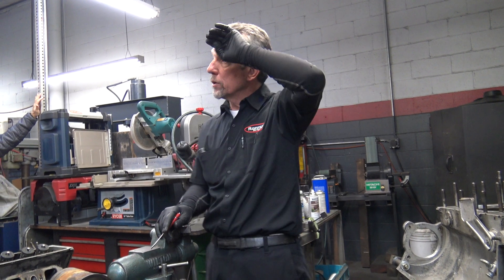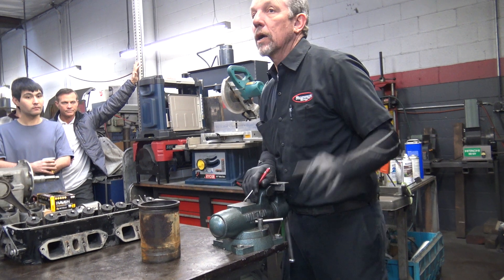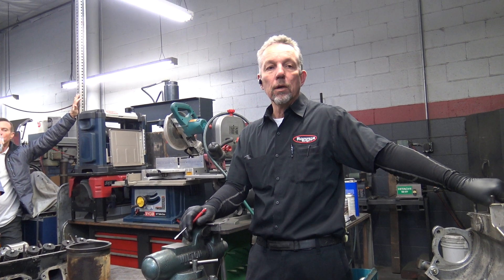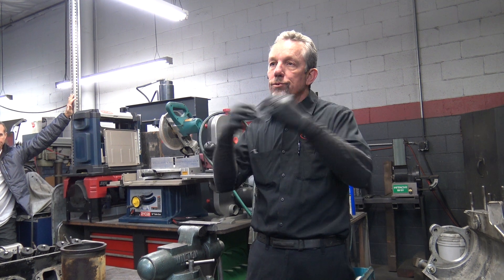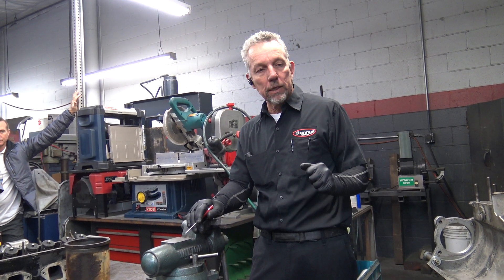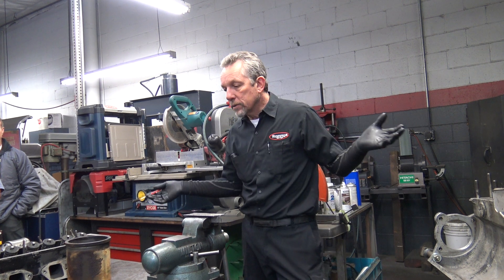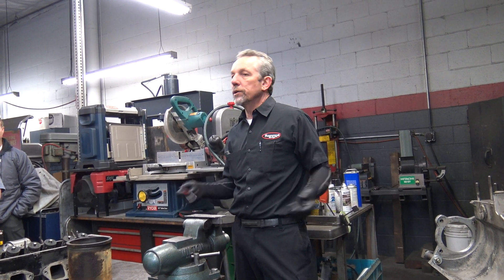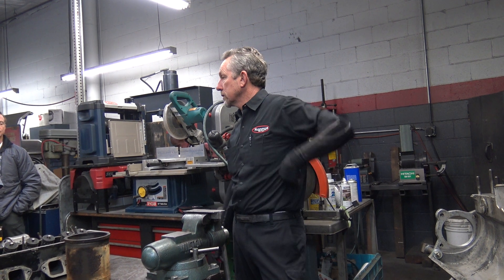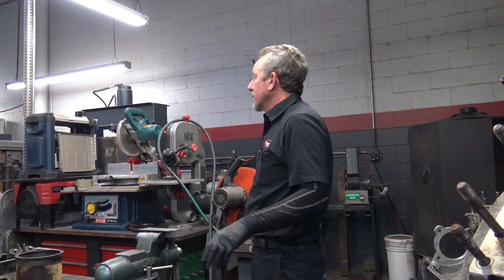The only danger is if you do have a coolant ring let go, it's going to go into the engine. When they leak coolant, you're kind of screwed. What I have tried with minimal success in the past is to clean out and flush the cooling system, use a chemical block sealant, and follow the directions. This one we tried was KW block sealer — I've had luck with it occasionally, but this one didn't work. You have to flush it out three or four times to get all the coolant out, put the sealer in, run it a lot, then drain it again and let it dry for a few days. It didn't work on this car.